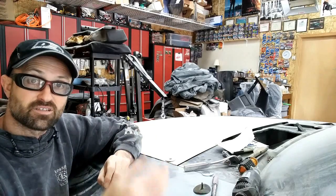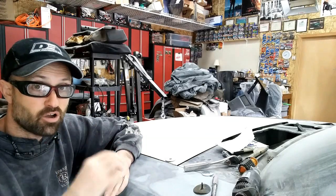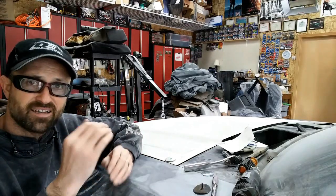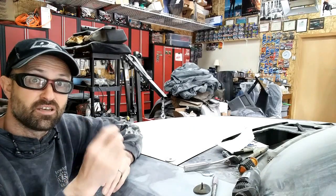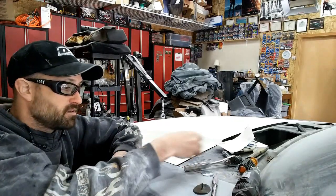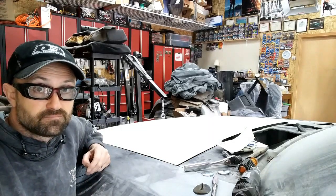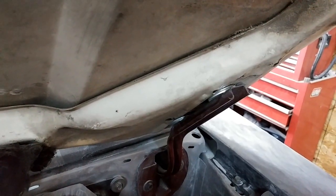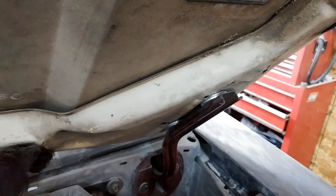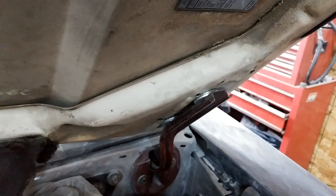Took the back one out, slid the 3 washers in, put the bolt back, and actually changed it to a little bit longer one just because I needed the extra threads, the extra extension to be able to get up in there. What that did now is that my hood is pretty darn close to that fender, straight across. There you can see just the balance between the 2 and the 3, just putting on top of the hood hinge and the hood itself pushing the hood vertically up.